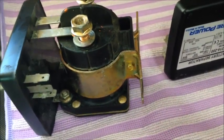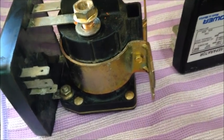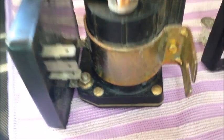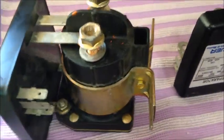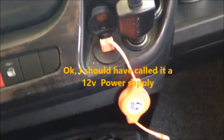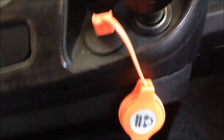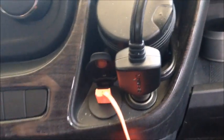It's not very smart on its own, but if you connect power and ground to the little terminals, it closes the contacts. So that's what I did. From my cigarette lighter, which is on the ignition — it comes on with the ignition when you turn it on — I ran a wire across the dash.